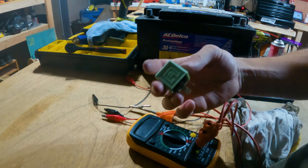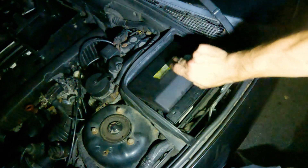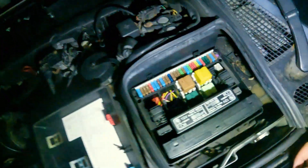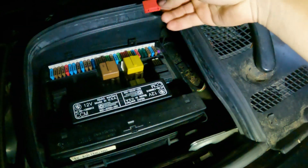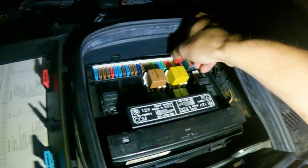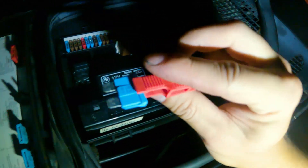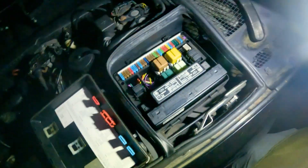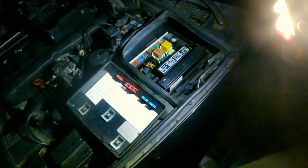My problem probably lies in the fuel pump or some fuel hoses. I should have checked the fuse first, but that's all right. We're gonna look for the fuel pump fuse — number 23. These are nicely labeled. I compared the fuse to another one and they look the same — it's not burnt out, not melted, seems just fine. So that brings me down to the fuel pump.